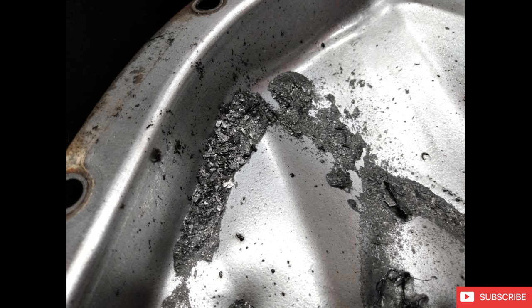But otherwise, it goes without saying they're very capable cars right out of the box in terms of rear end and axle. Chassis, they don't need really any sort of reinforcing or stiffening. The rear end was a 3.27 ratio, which is excellent for any sort of boosted application. Some of these guys will go out and immediately throw 4.10s and really aggressive gears at it. I don't think that's necessary.